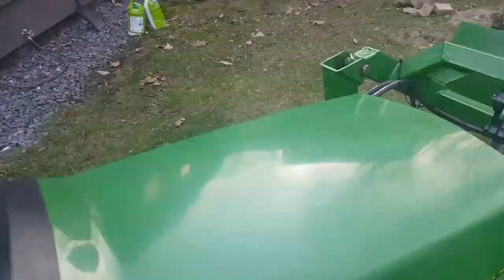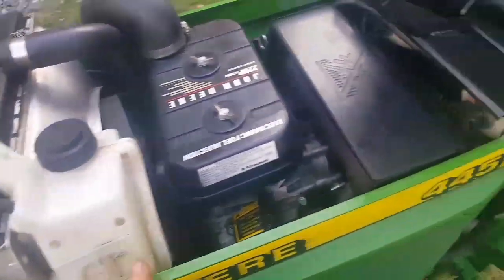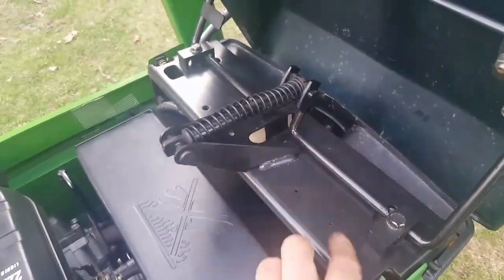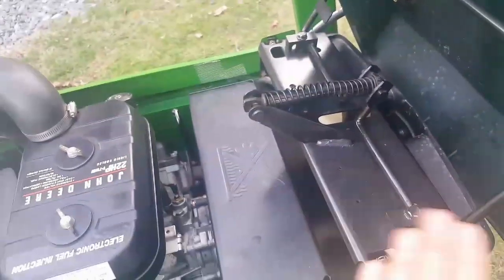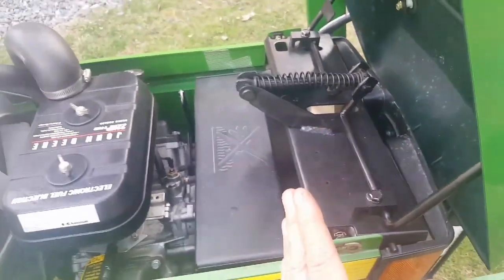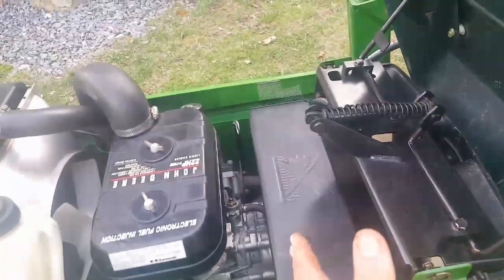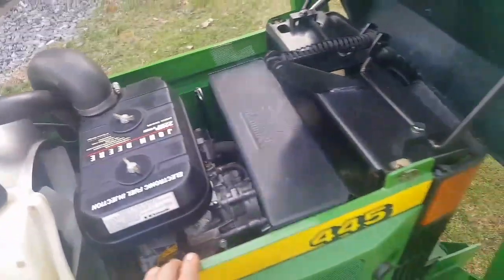Oh, a couple of notes about the panels, in fact, and the hood. When doing the final reassembly, when putting the panels back on the hood, I found that I was about half an inch out between the fixtures for the side panels, and the hood wasn't closing properly either. Well, turns out that this front section here that has 2 bolts either side going down onto the main chassis, when I was reinstalling it, there is a certain amount of movement to be had, and you can lock it in. You have to choose where you're going to lock it in, I guess. And the natural inclination for me anyway was to make it as vertical as possible. Doing that, I was actually tipping it back by about half an inch. I loosened up those bolts, moved it forward, and then the panels fitted properly and the hood came down properly as well.